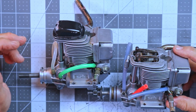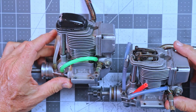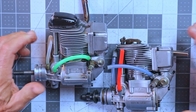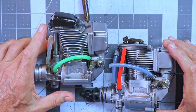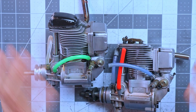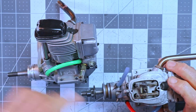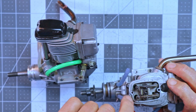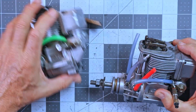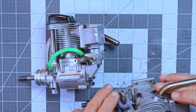I'm not commissioned to service them and I certainly don't have the time to just sit here and play with them. YS engines are considerably more challenging to work on, and they're certainly more expensive to work on. Finding any replacement parts is getting hard to do. Anytime you disassemble a YS engine, you automatically better have a gasket set on hand — because if you don't, it won't seal properly. It's critical that the valve cover is sealed, because that's part of how it provides pressure to the engine.